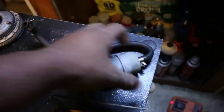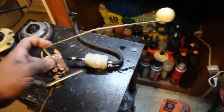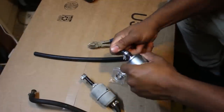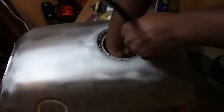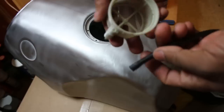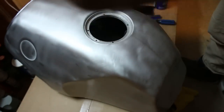With the K-bike, the fuel pump sucks fuel through a screen, sends it through another filter, and down into the fuel rail to all four injectors. The other end of the fuel rail runs into a pressure regulator which sends excess fuel back into the tank, keeping the whole system pressurized at a specific level. This fuel injection system still scares me — if this bike were carbureted I'd have taken it upstate already. With so many things that can go wrong, I keep doing shakedown rides to make sure my wiring job is okay and that the injection circuit is reliable. Under the recommendation of Didstang the K-bike builder, I'm not even running the throttle position sensor.